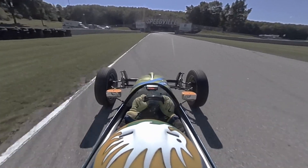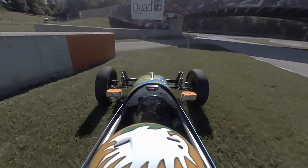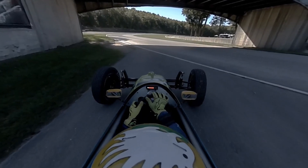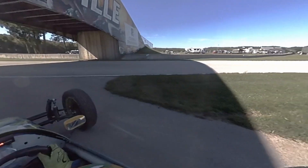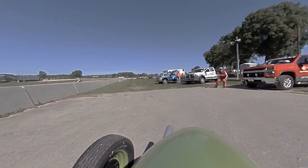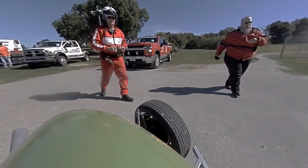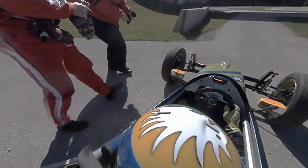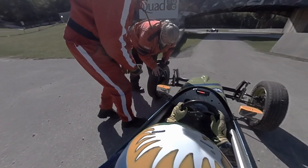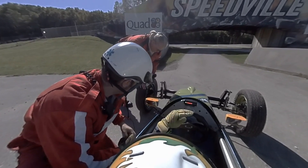It's a seven-inch-long grade eight, five-sixteenths bolt. The head end is beveled so that it can ride up against the bearing adjustment nut. The other side on the kingpin is double-nutted — it rides in there loose so it doesn't put pressure on the bearing. Between sessions you can try and turn the double-nutted end; if it turns freely your spindle should be good, if it doesn't you should really check your spindle.